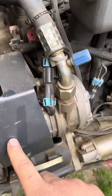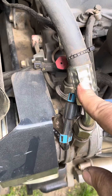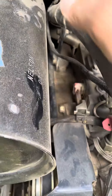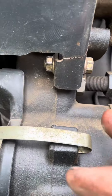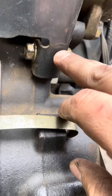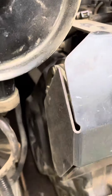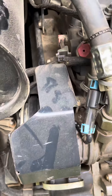Then you're going to loosen this bolt. These hoses also don't really want to move, so you're going to have to loosen that nut as well — that's going to allow the hoses to flex a little bit. Then you'll take out this bolt — you can see mine's actually cracked, I didn't even notice that, that's crazy. You're going to take out this nut and bolt to get the cover off, and there's an eight millimeter socket in there that you're going to have to loosen as well.